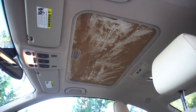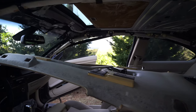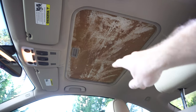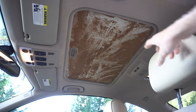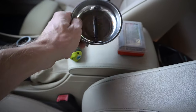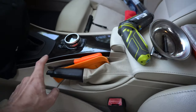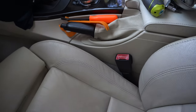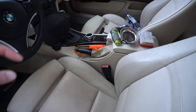And in today's video, we're gonna go from this to that. Step one, we need to remove every item which is sitting on the headliner, like lights, shades, handles, plastic pillars, and so on. For that, we're gonna need a T20 screwdriver, either I'm using the drill, a pick tool, or a flathead screwdriver, the tiny one, and a plastic pry bar. Also, everything you're gonna need, you're gonna find it in the description below.